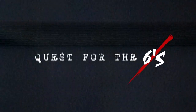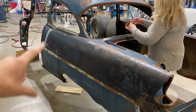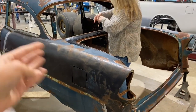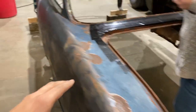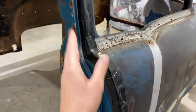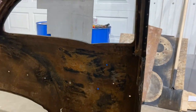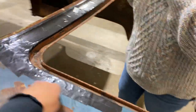I'm gonna flip this around so you can see what's going on. Basically we want to keep all of this patina as much as we can. We've got to cut the lower quarter out, replace rockers, which will fake that back in. So we've got to keep our paint looking good when we sandblast, but get all the rust out in the jams, and then we're gonna sandblast in the doors here so that way they'll have a nice finish, and then sandblast in here. Doing it before we put the quarters on because that's so rusty and trying to weld to that. Mom has been taping queen today, going around taping on the edges.